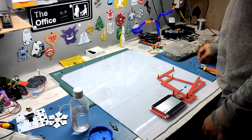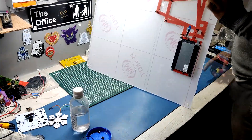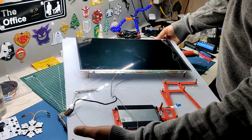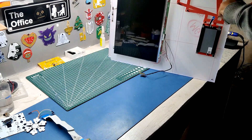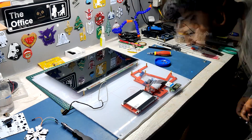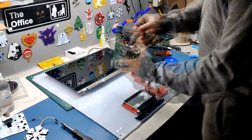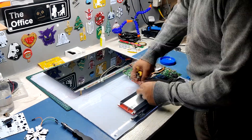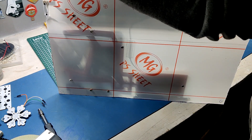To avoid attaching the motherboard directly to the acrylic sheet, we first attach the 3D printed motherboard holder to the base sheet using M3 bolts and nuts. This section also holds the hard disk drive. Then we use four 20mm long M3 PCB standoffs to mount the display to the base acrylic sheet. Next we place the IO expansion board using the same 20mm long M3 PCB standoffs. Using double-sided tape, we attach two speakers — one left and one right — to the bottom side of the PCB. The motherboard is then set into position by connecting it to all FPC connectors including the display port, charging port, on/off switch, hard disk FPC cable, speakers, IO extension board, and Wi-Fi module. Now that the motherboard is attached to the base sheet, we may remove the acrylic cover to reveal the transparent sheet.